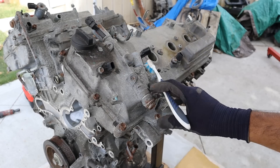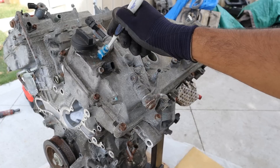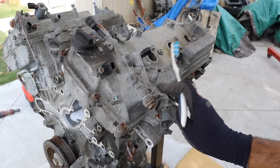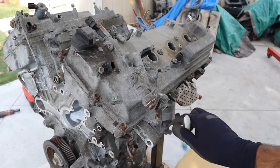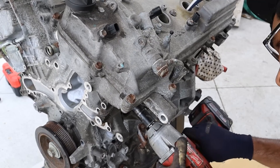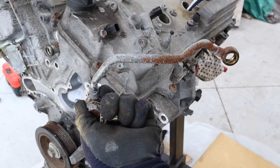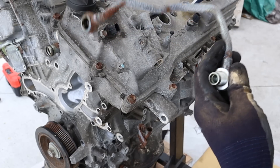Here's your belt tensioner assembly. Now the valve covers are metal and for good reason — we have variable valve timing solenoids that run directly to power your VVT gears. This engine has variable valve timing on both the intake and exhaust side. Over here we've got this metal pipe which is actually the oil feed. That is another weak spot on earlier versions of this engine where they used to make it out of rubber — it would deteriorate and burst, causing loss of oil pressure and potentially shutting down the engine. There was a recall prior to 2010 to replace this with a metal line.